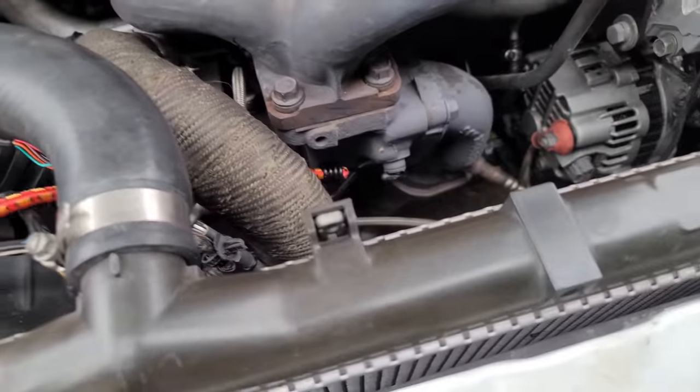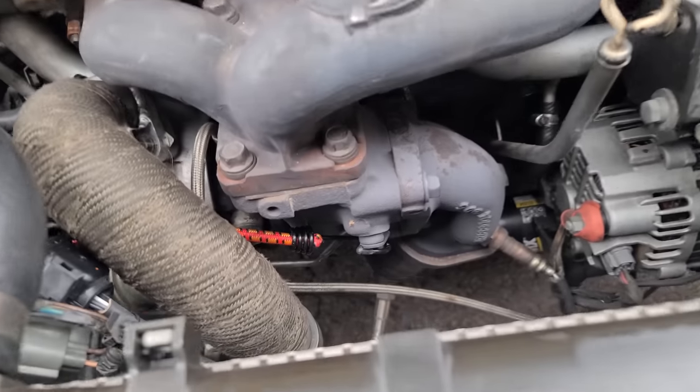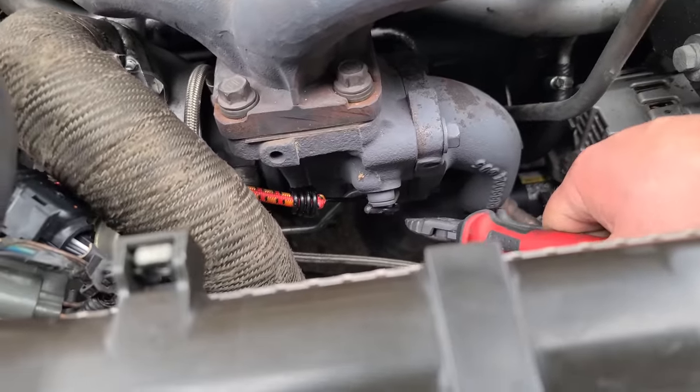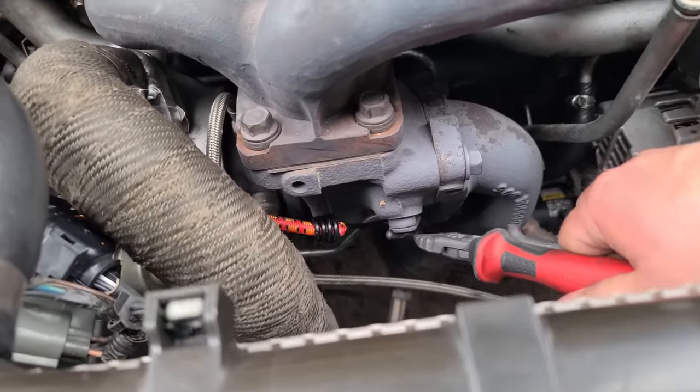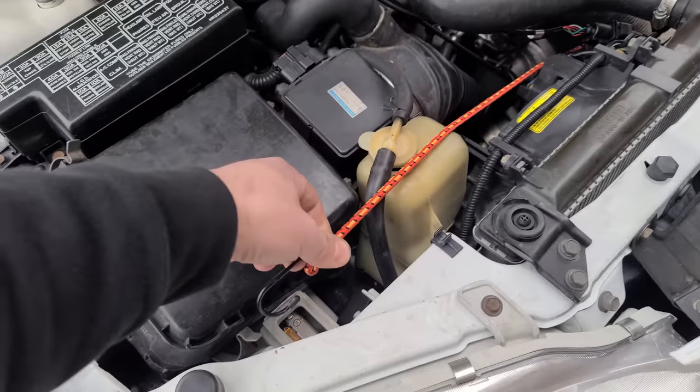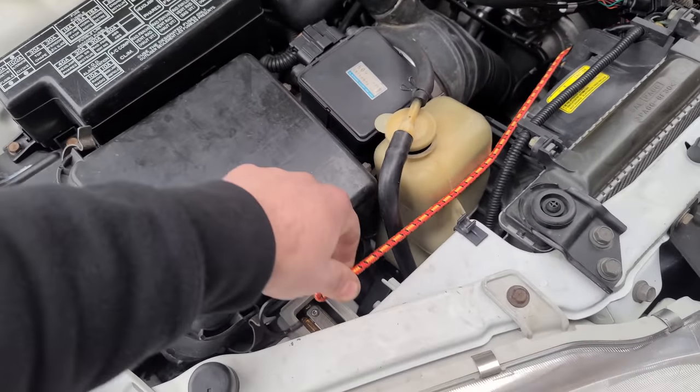But fear not, Peter and I have come up with another idea, which is a bungee cord. So we've taken off the rod from the wastegate actuator. That's melting a little. Just a little. Yeah, just a little. And we are going to keep this wastegate shut. I mean, it'll still have some tension. The bungee cord is now going to be the boost pressure limiter.